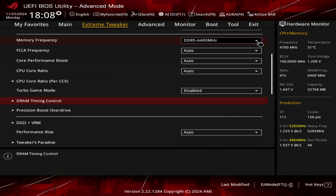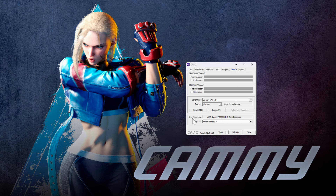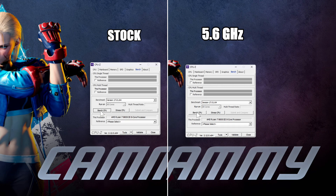I'm just going to jump into Windows now and show you guys what you get for doing all of this. I'm going to run a quick CPU-Z test with the multi and single-threaded tests. This will give you a quick assessment to see if your overclocks work. On stock it's getting around 8,800 almost, and on the overclock to 5.6 GHz it's getting 9,200 plus. Single core is getting 833 versus 893, so you can see there's a good increase in single-core performance.